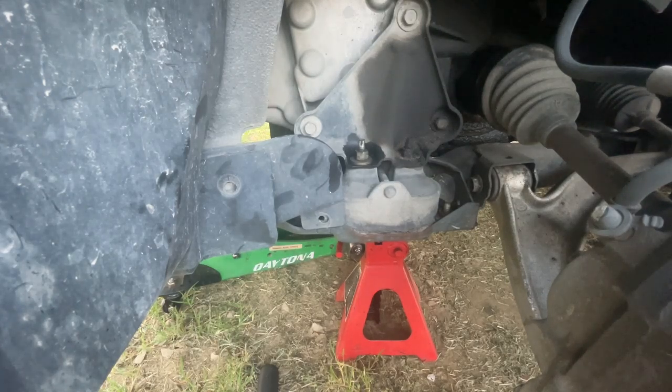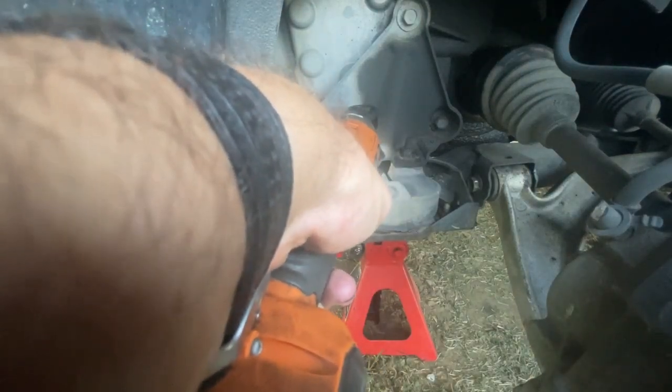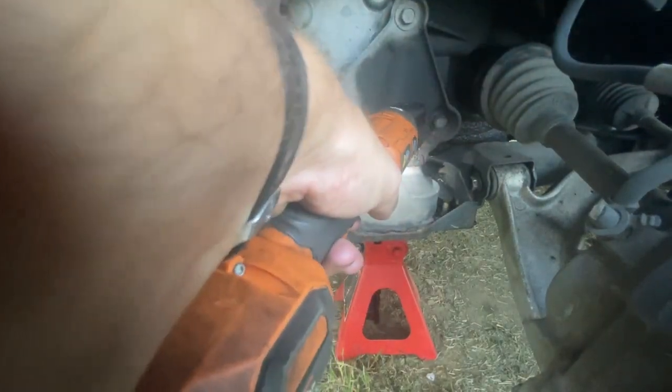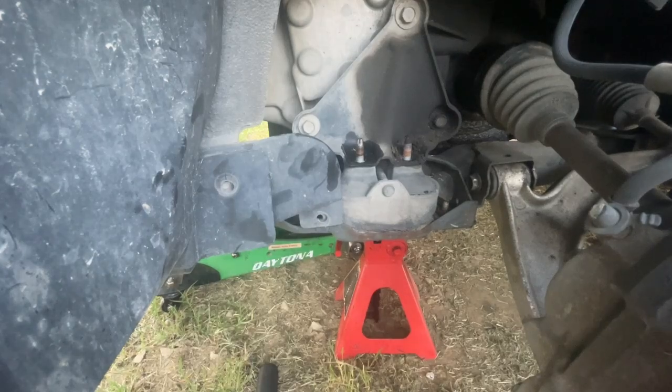We got it out — had to put the pickle fork in from the front, then hold down on it and smack up top of the pickle fork, and it pushes right out. So we've got the control arm out. Now we can get this mount off. Those are 15 millimeter nuts on top, so we'll get in there and take those nuts off, then get on the bottom and get the two bolts out of the bottom of the mount and jack the engine up.